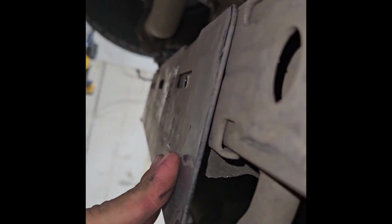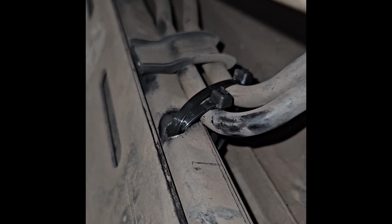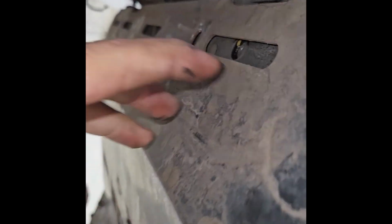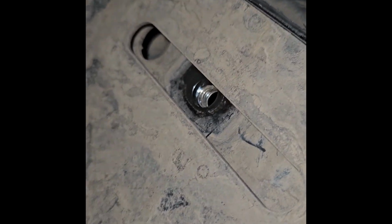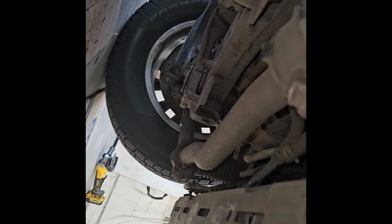After those modifications, this is how it sits. This is my factory Ironman filler plate. It sits flush against the bar, and you can see my zip tie contraptions are clear of it. And because the skid plate kind of sits at the bottom of these little tabs, it holds it in there pretty good. So I think the lines are secure enough, and now I got to put up the skid plate. Make sure that you have these slots lined up. That's the one big bolt, and then there is the 12mm bolt. So it should go up just fine now and sit underneath this plate, I think.